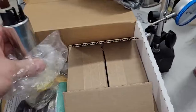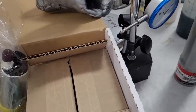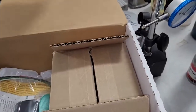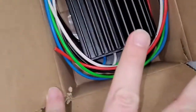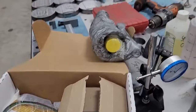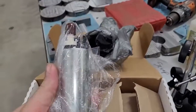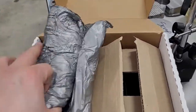This is a Veyron fuel pump with a brushless DC motor. One of the reasons we did this is it should be OEM reliable — they put this in a production car. I haven't had great luck with aftermarket pumps, so I'm hoping this one is more reliable. It's got four wires coming out for the pump, two wires for power input, and it has this little amplifier-looking electronics module that runs the pump.